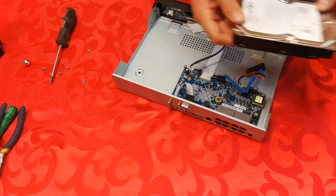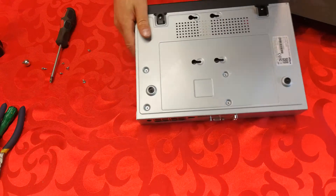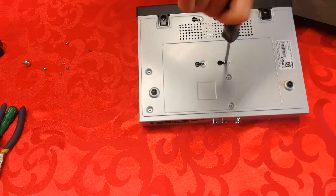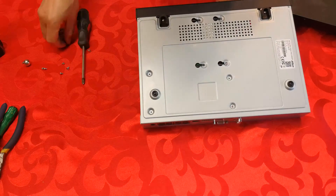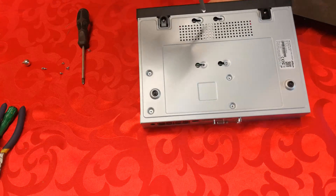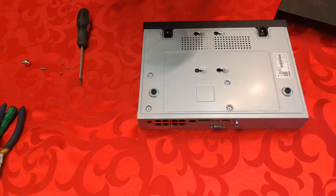Taking the faulty one out and putting in the new one. I'll plug it in now. Flip it upside down and align the screw holes. Some people cut corners here and only put in two screws, but I don't recommend that because the hard drive vibrates and actually rattles. So I'm going to put back all four screws.